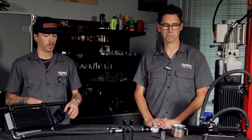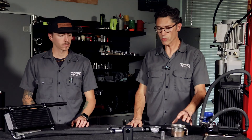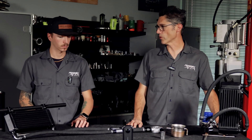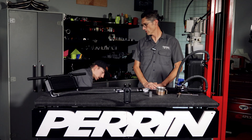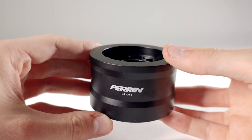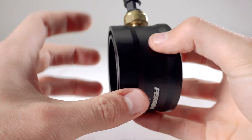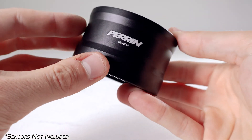We've had our standard oil cooler kit for quite some time and have also released upgrade options. If you already have a standard oil cooler and want to upgrade to the top mount, you can — we have a kit that includes the two hoses, mounting brackets, and a new thermostat spacer that allows it to work, so you can reuse your existing oil cooler. Here's the thermostat spacer — it's brand new for the top mount. Because it's taller, we can add ports for extra sensors, and an adapter with extra ports is included.